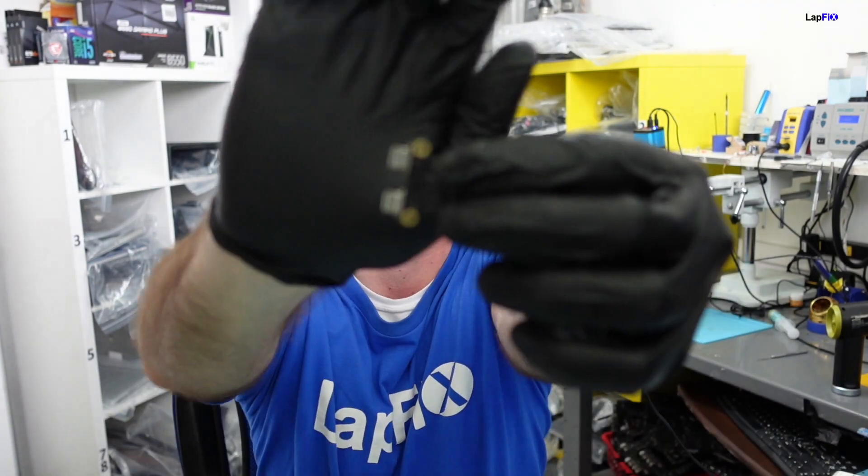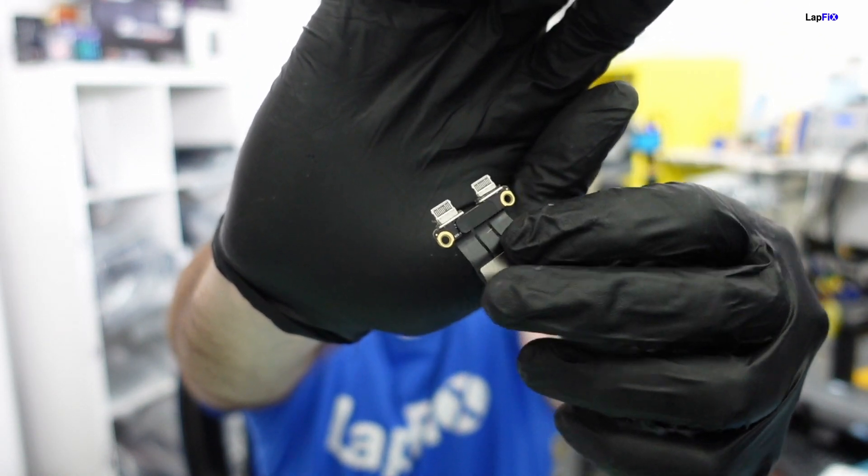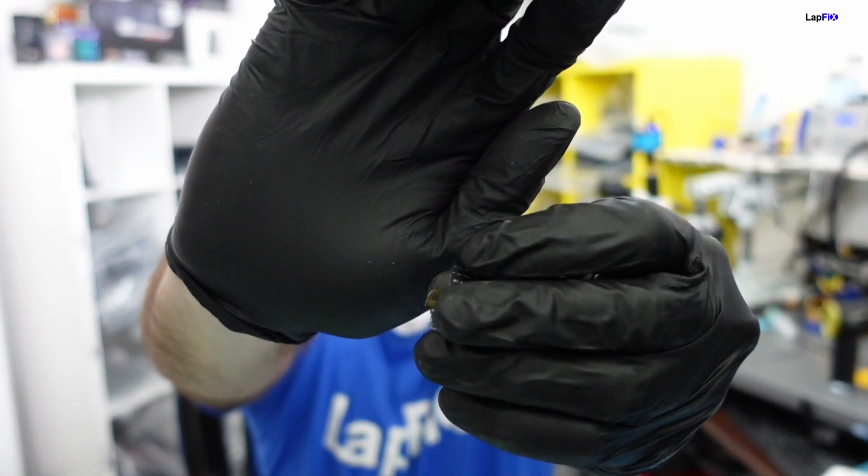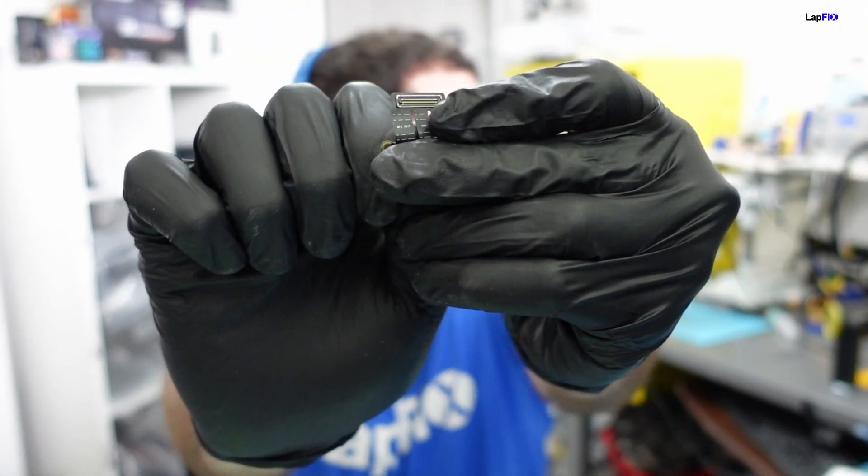We also have a small USB fan here for the fix. Another approach if debris was really stuck would be to open up the laptop, remove the ports, or even remove the whole board — a lot more work. If there were damaged traces, we could replace the modular USB-C port connectors. Some models like the A1708 (2017) have soldered USB-C ports that require desoldering — a real pain. These M1 modular ones are much nicer.